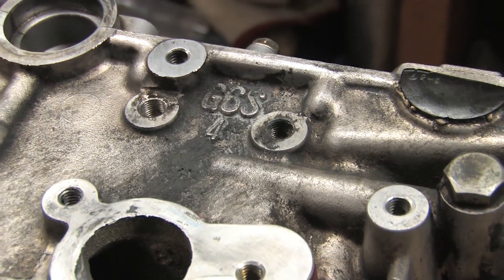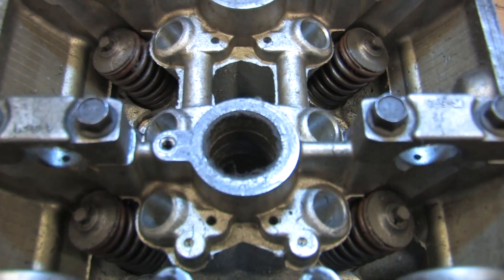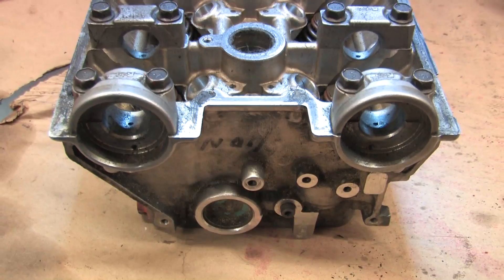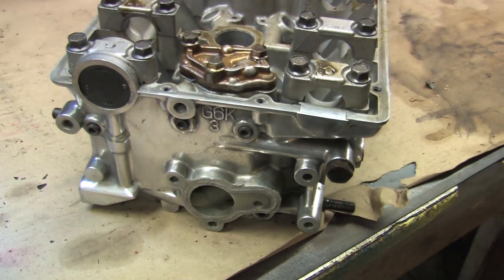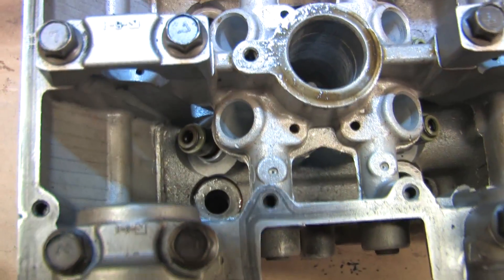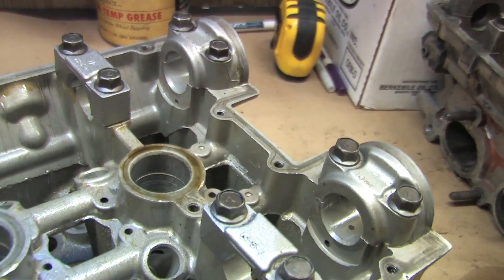There are other variances in these castings. The spare cylinder head is a G6S casting, and it has the more shallow oil port. You can easily see the casting marks on the thermostat housing side of the cylinder head. Inside the head, the oil galleries on the G6S don't go all the way through — they end just before reaching the outer casting on the timing side. My G6K, which came from an October '94 second-generation GSX, has the deeper oil port, and those lifter oil galleries are both cast and drilled all the way through the cylinder head with plugs on both sides. The depth of the teardrop was 101 thousandths before I milled it. If you can see the face on the timing side of a head, you know you have a G6K — once you see it, it can't be unseen.